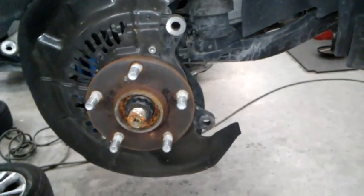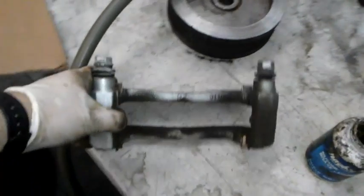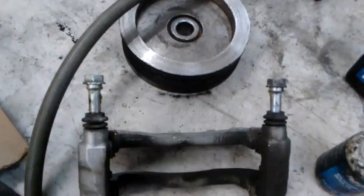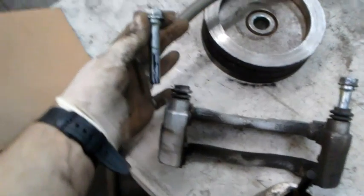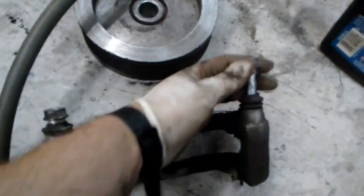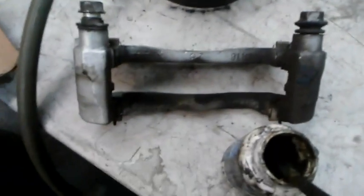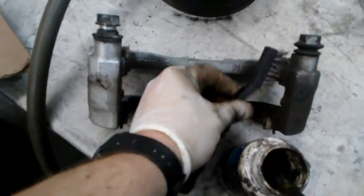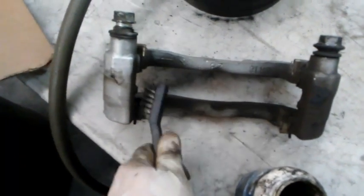If you're not machining your rotor, you can skip this part and you don't have to take your bracket off. Now we're gonna lube these slide pins. I've got a general bottle of lube here. I'll pop these out and put lube on them — you don't have to go crazy with it, just a little bit — and then I'm gonna do both sides. Notice this one has a black ring on it, that's the bottom. Put the lube on it and put it back in. Then I'm gonna take a little brush and clean up the hardware on here, get all the dirt and rust off.